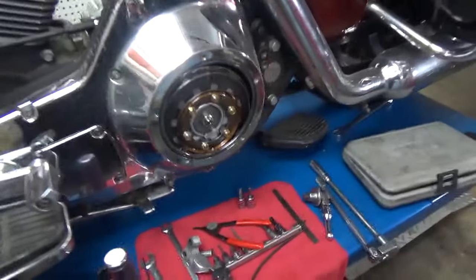When I put the lube down into the cable, if I could have left it overnight I would have. What you're trying to do is get the lube to go down this curve — the further down it goes, the better it lubes. If he just goes home and parks this in the garage, it's going to work better tomorrow than it did today, just from that stuff sitting in there. On the other end, the transmission lube is actually running down that cable for a section. So it's a good system, really — I'd just like to see it a little easier to work on if somebody has trouble out on the road.